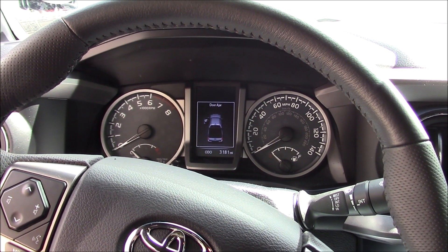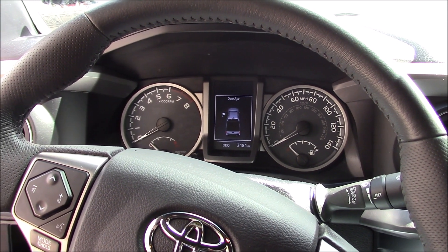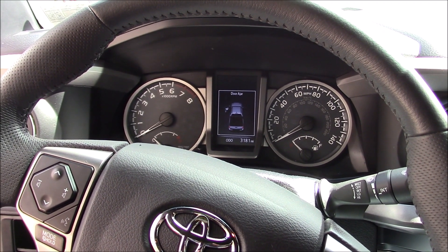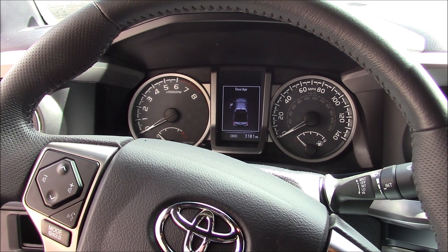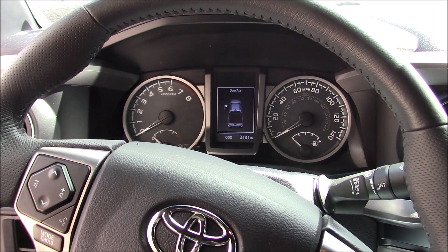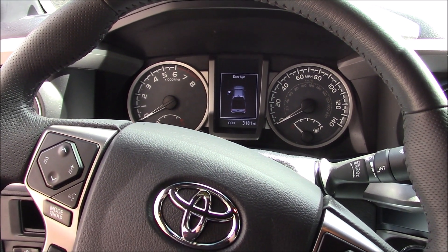Also, no more than 30 pounds of air pressure — I'm talking about my size tires on this truck. If you go up to 36 or 40 pounds, with the lift kit and big tires you're going to feel it in the steering wheel and it doesn't feel good. Take my advice there.